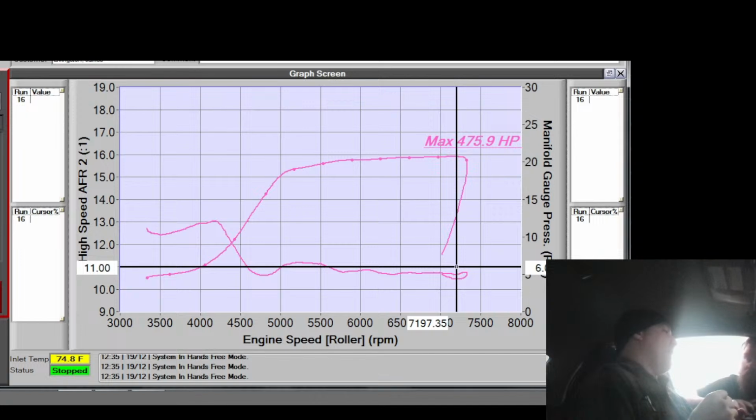So the light one now, you can buy different weights. I'm making different weights for it, and it's a press fit. So I have index rods that come in a kit, so you can heat the damper or heat the pulley in the oven, and then put the steel piece in the freezer, and have the threaded rods in the guides. You just set the pulley down and then drop the steel piece in, because the aluminum expands more than the steel would anyways. So even though it's press fit, it lines it up, just drop it in.